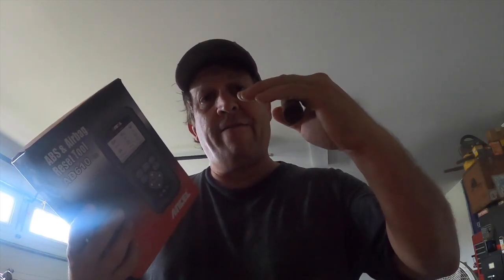After I changed my Clockspring, what happened was the airbag light wouldn't go away. The SRS light remained on. One thing changed, and that was the light came on, went off for 5 seconds or so, and then came back on. I couldn't get that to go away. Before I changed my Clockspring out, the light would just come on and be steady. So there was something wrong with the Clockspring to be sure, but I couldn't get the light to go away.